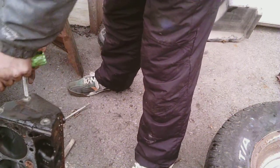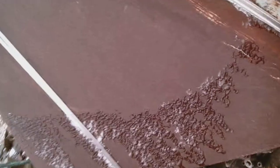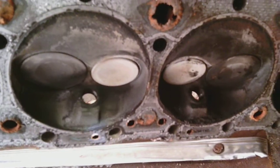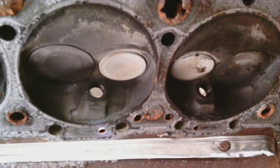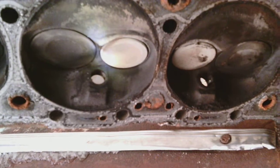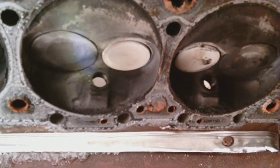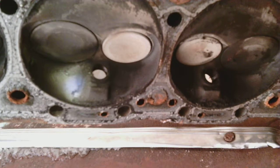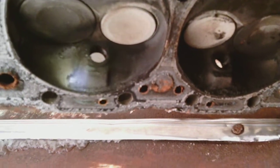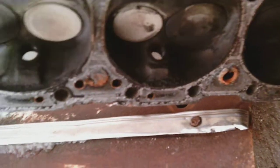So, maybe you can see that. See if we can see the crack. Yeah, you should be able to see that, I would think. See that line right there, right above the spark plug hole? Yeah, that's cracked. It's odd, because usually I see a crack from the spark plug hole to the exhaust valve cracked through, or sometimes between the intake and the exhaust valve, but this is weird. It's just a lone crack on the spark plug hole only, and I think there was one other